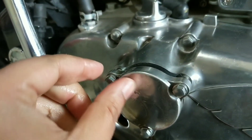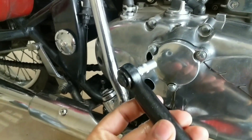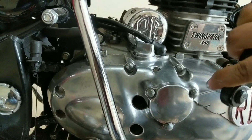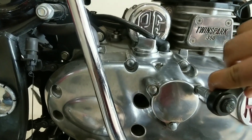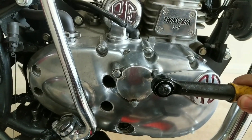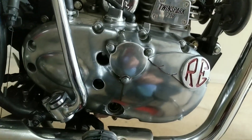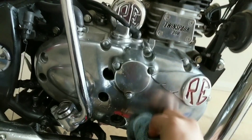I've hand-tightened the bolts. Now I'll push the cover in and properly tighten all the bolts with the wrench. Tightening up all the bolts properly — again, don't over-tighten them. I've installed the oil filter. I'll clean it up with diesel again to make sure the engine is clean.